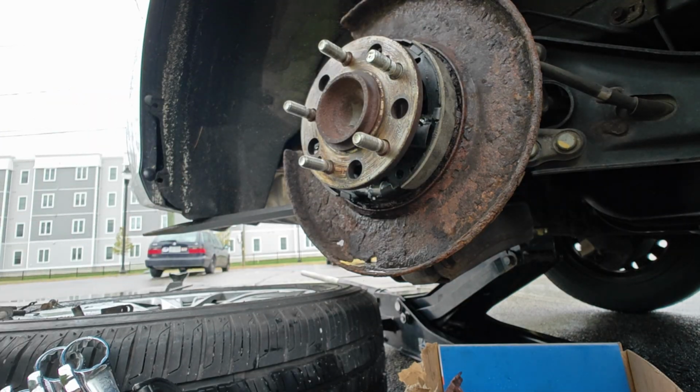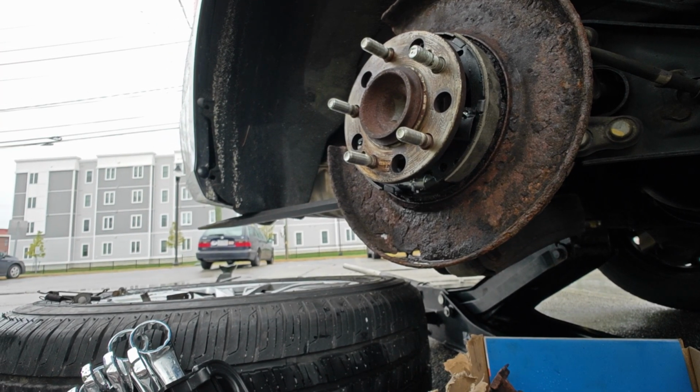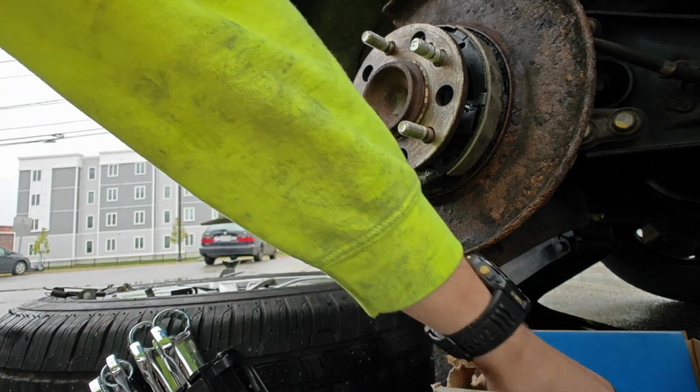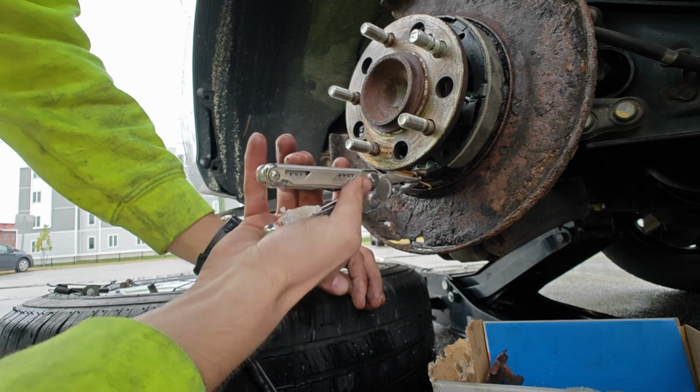So to put the adjuster in, it's just fitting it against the bottom of the brake shoes. It's just a friction fit, it's not very tight, but there's two slots and the adjuster goes in between the brake shoes. This thing right here. Next is this spring. It goes from triangle to triangle on either side.